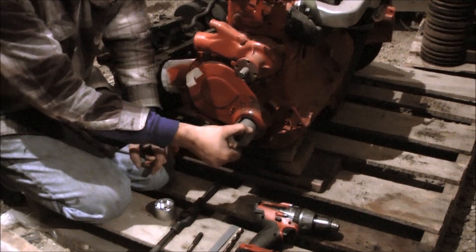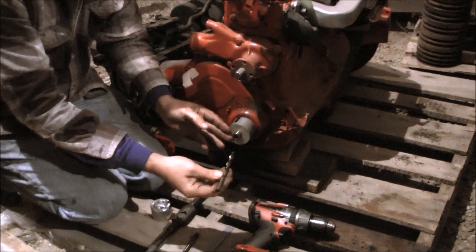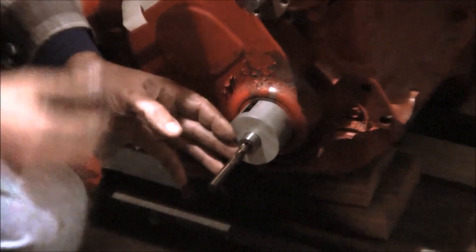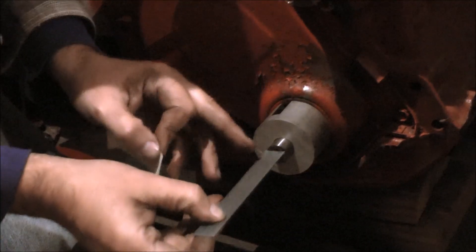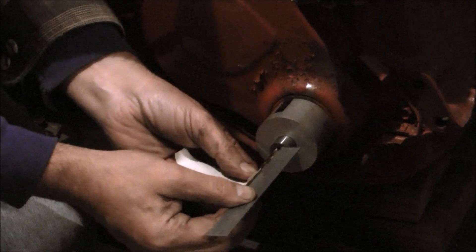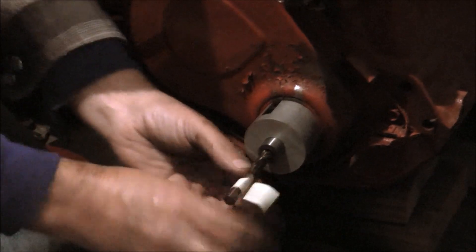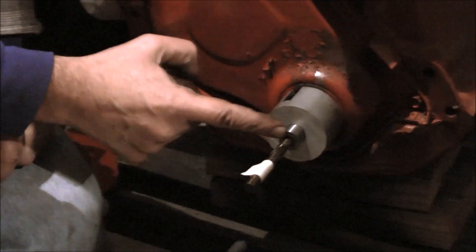You can do this with the timing cover installed. So you'll slide that onto your engine and seat it in all the way. Take your W drill bit and insert it into the tool and seat it. Use a piece of tape — measure from the backside of the drill bushing an inch and three-quarter. You want to drill a pretty deep hole into that crankshaft, so it'll go inch and three-quarter. Simply put the piece of tape on there; that's going to be your measuring stick as you're drilling your hole. Drill down until your tape touches on your drill bushing — you've then drilled far enough into the crankshaft.